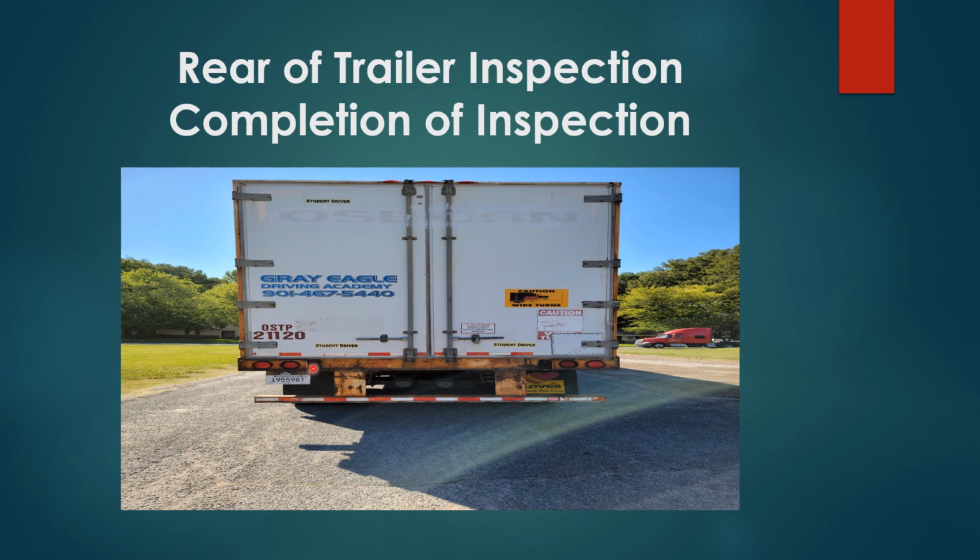Rear of trailer inspection. You have your trailer door, hinges, and latches. Properly secured, no damages. DOT reflectors, properly secured, no damages, more than 50% visibility. Brake lights, running lights, properly secured, no damages, no cracks. Your license plate is properly secured, no damages, and light, properly secured, no damages. And that completes the overall inspection of tractor and trailer.